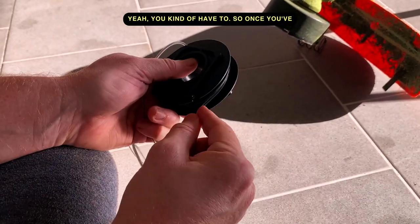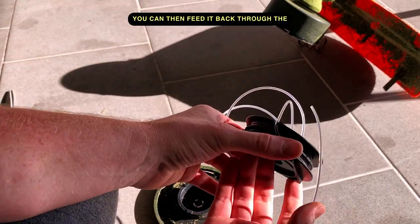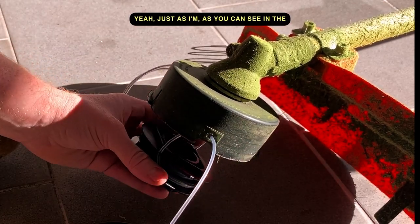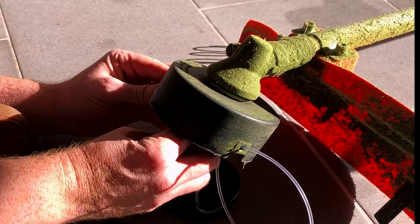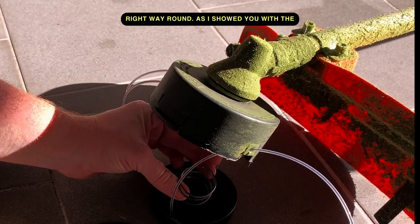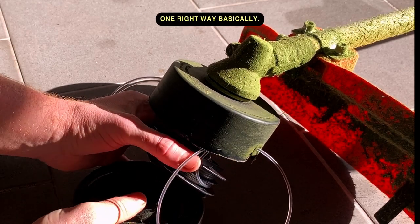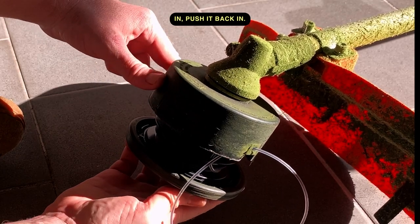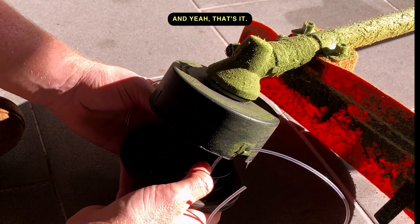Once you've got the wire wound in, you can feed it back through the little holes in the strimmer — just as you can see in the video. Get the spring back in, and make sure it's the right way round, as I showed you with the three little dots at the bottom. There's only one right way. Then just fiddle it back in, push it in, and once it's clipped in, you're done.